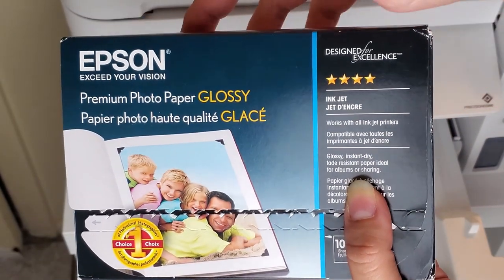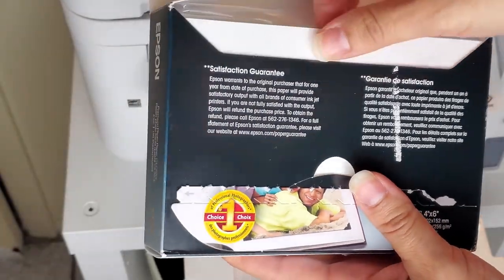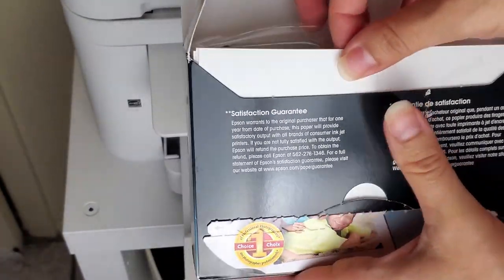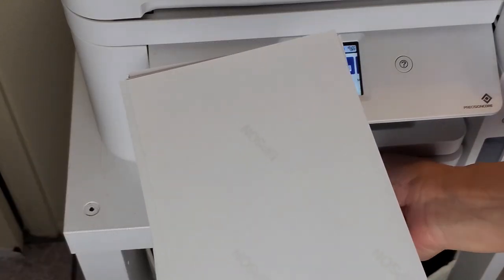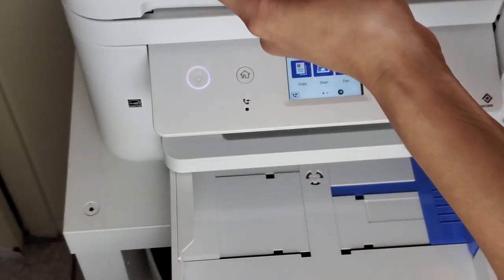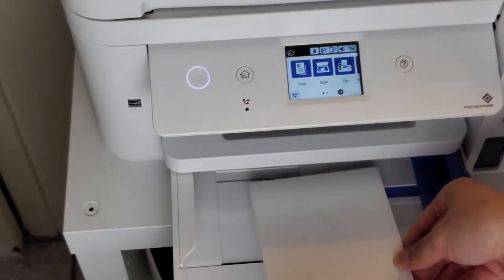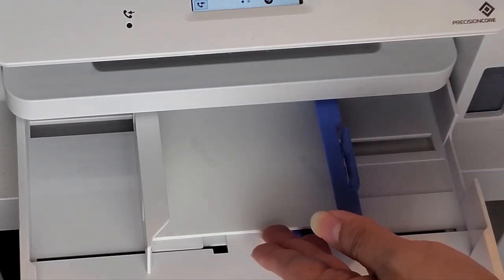For the Epson paper I showed you — I got it on Amazon and will provide the link in the description. The papers come nicely packaged in cellophane wrap. I'll take a couple of sheets out. You'll notice it says 'Epson' on one side — that side will be face up, and the shiny side will go down. Go ahead and close the tray, open the paper feed, remove any regular printer paper, put the photo paper in with Epson facing up and shiny side down, pinch the little lever to close it, and make sure it's pushed all the way back.